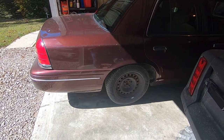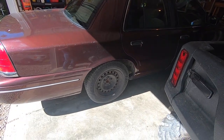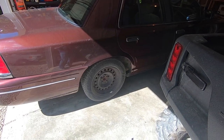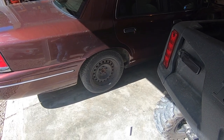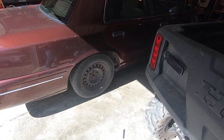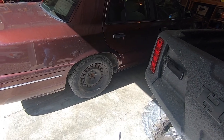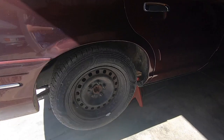It's actually not too bad of a project. We're going to jack up the back of the car and put jack stands under the frame — you can't put the jack stands under the axle because we're going to have to let the axle drop. Then we're going to unbolt the shocks. On a lot of these cars, just unbolting the shocks is enough to get the old springs out and get the new spring in without a compressor.